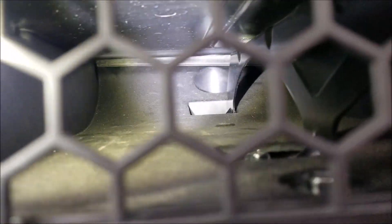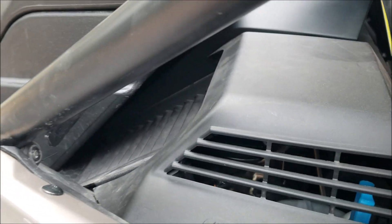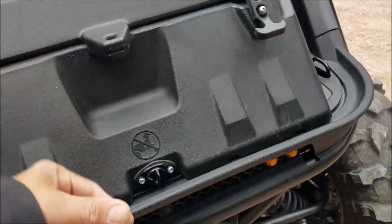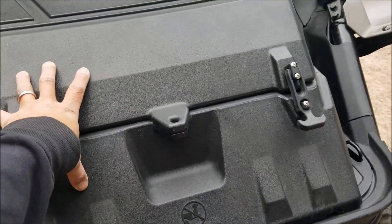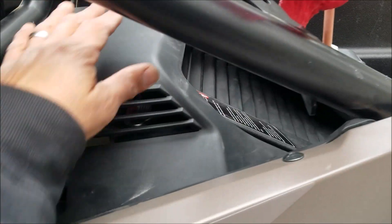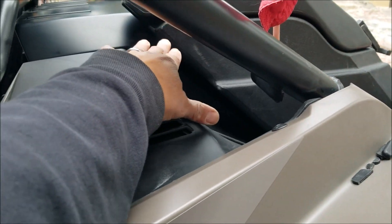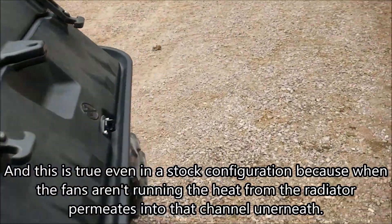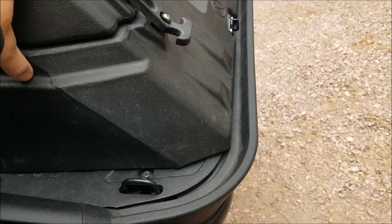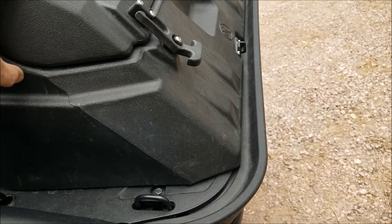Just a back shot of my rubber block-off — it blocks off both sides of the channel. So a final thought: if you reverse your fans, remove that channel in the stock shroud, and block off the channel going back here, you're blocking all heat from going under your cargo box and it will stay a lot cooler. You have the shroud to deflect heat this way, and you could put some heat insulation here. In the summertime, if you use this as a cooler, it's going to run a lot cooler because there's no heat going underneath it — it's been blocked off.